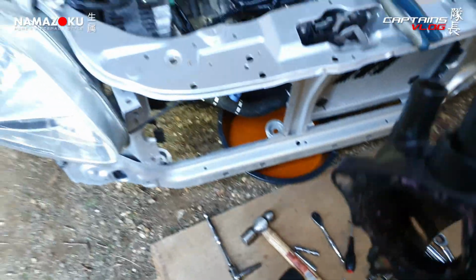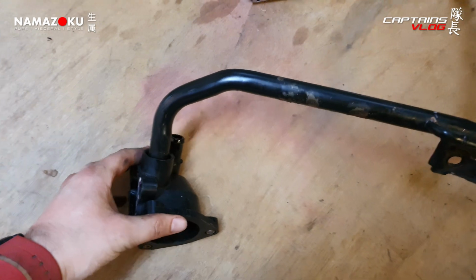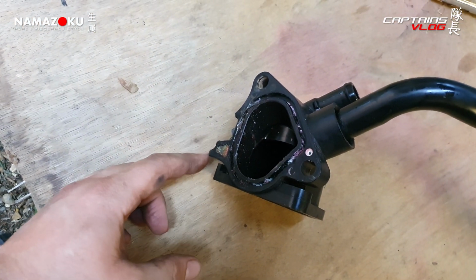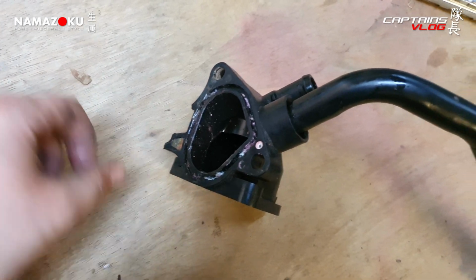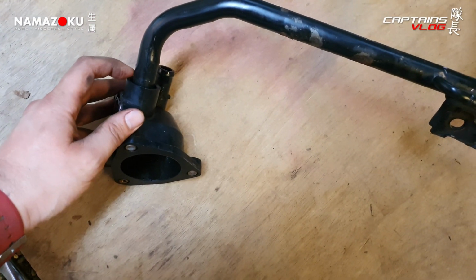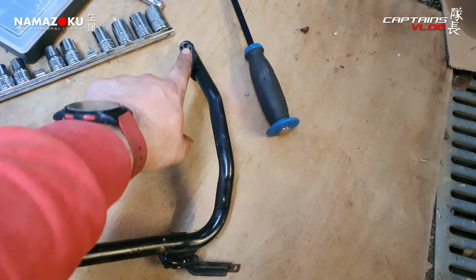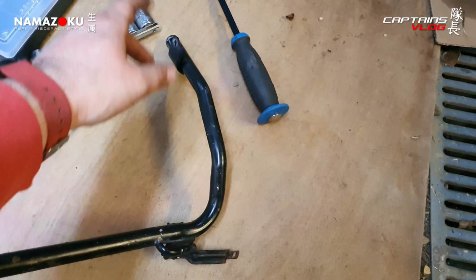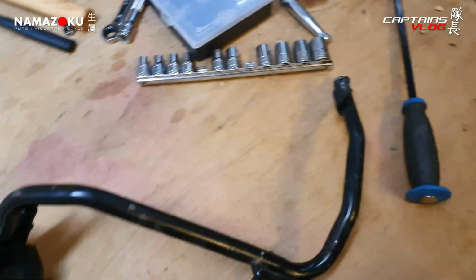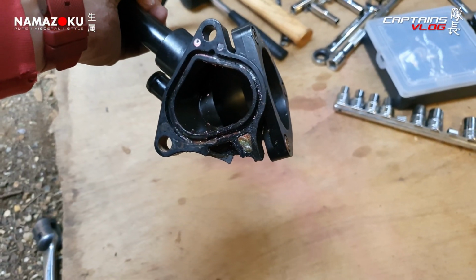So, what I was trying to change was this piece. I'll leave it down there. This fucking hard line. So, that's your thermostat housing. It was. You see it's all snapped lovely now around this here where that third bolt was rusted into the water pump housing. This is just on an O-ring, but fuck me, it's so tight in there, you ain't getting that out. Plus, this side of it goes up the right-hand side of the valve cover, and you've got sensors and fuel pipes and friggin' wiring loom and shit all in the way. So that weren't having none of it. So I've literally just yanked the fucker clean out of the hole.